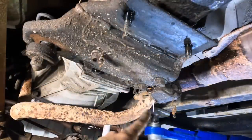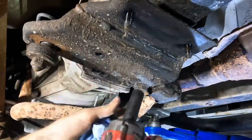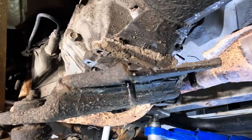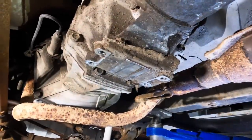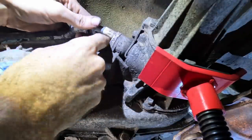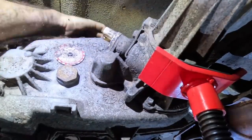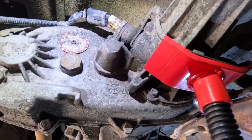We also have this plate right here which serves as an exhaust bracket. I don't think I need that right now, so let's take that off as well. Because the exhaust is also coming off — I can't pull the trans with the exhaust in the way. Looks like we've got a speed sensor connector here, let's get rid of that. Something for the transfer case — I can't reach that one yet, I'll do that when I let this down. Let's turn around and pull this driveshaft out.